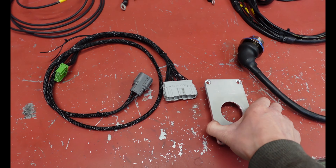First thing I want to do is get this plate mounted to the firewall. I've already gone ahead and mounted my catch can here because I knew the catch can would be fairly close to where I'm mounting the plate, so I wanted to make sure this is mounted first. Ideally the plate would mount just to the middle of this opening, but I'm going to have to offset it a bit otherwise it's going to come into contact with the catch can. So to do that I'm going to enlarge this hole. This strip of tape here is the edge of the plate and I want it about a quarter inch in from there. I'm going to take out the grinder, cut this away, test fit the plate, and then bolt it in place.